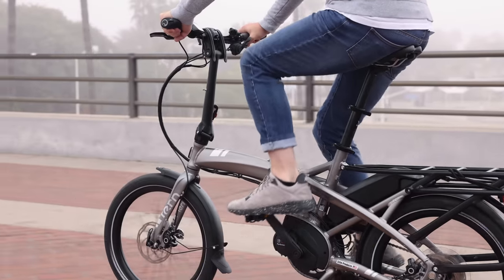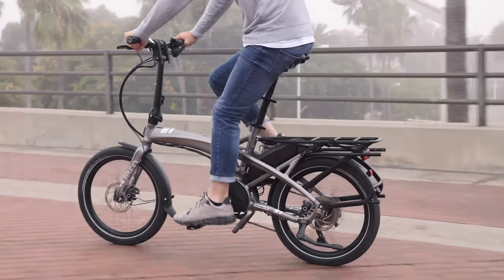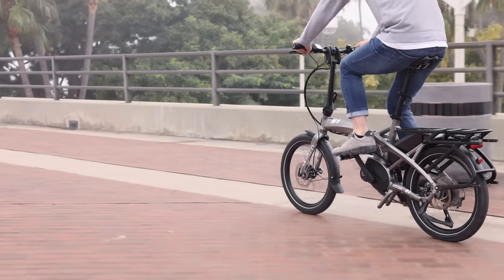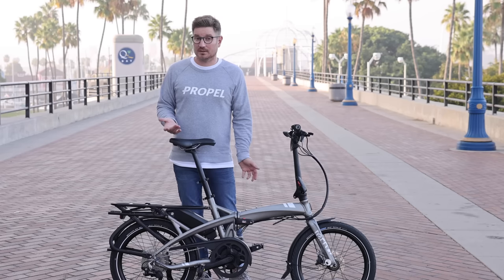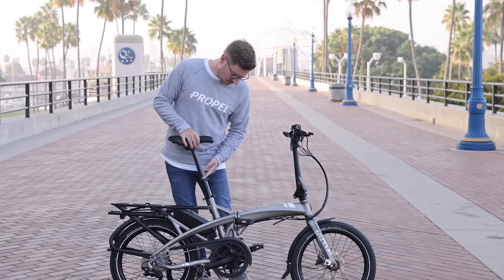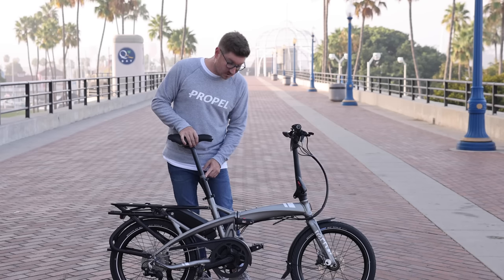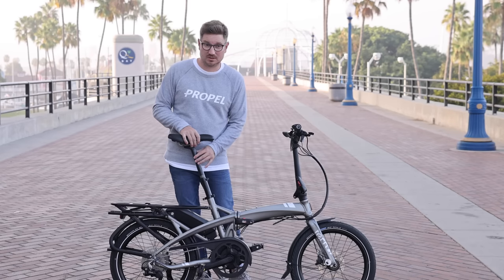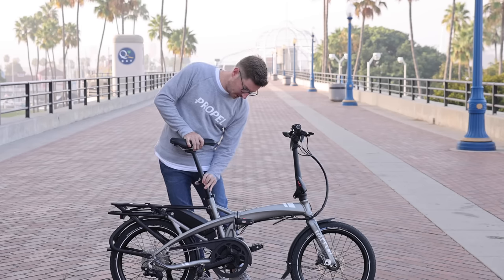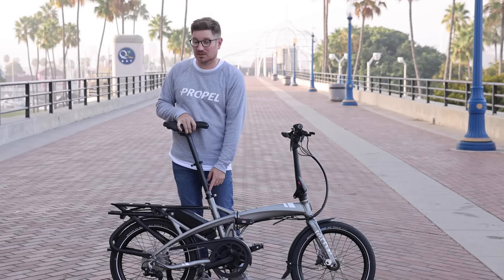Despite the fact of it being just one frame size, it can fit a wide variety of riders. This is actually one of the go-to bikes for people on the shorter side, because it can be difficult to find electric bikes for shorter riders, more specifically riders in the low five-foot range or even potentially below five feet. Part of its ability to fit different rider heights is due to its telescoping seat post — there are actually two different levels to it. The seat post is 30.9mm, so if you ever wanted to swap it out for a suspension seat post, you can. The lower portion is 34.9mm.